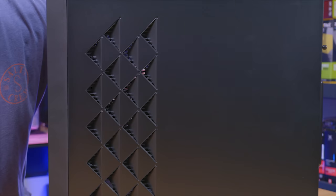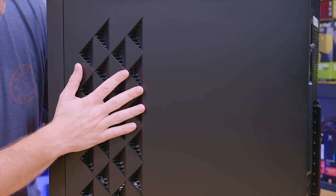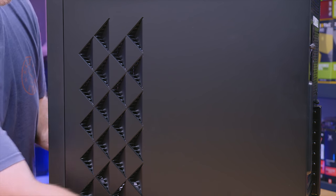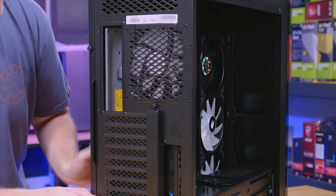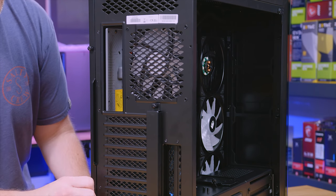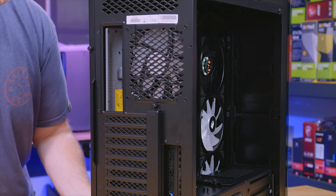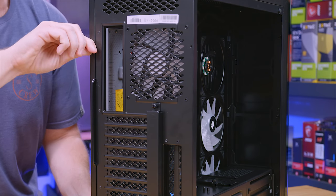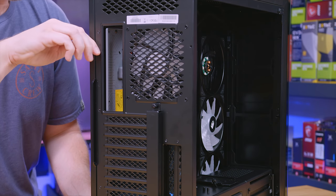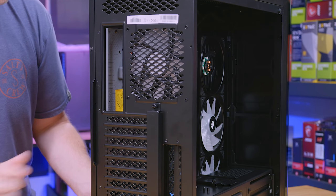You can see on the back right here, this is where it exhausts the air from inside the case — it's an exhaust, so it is pulling fresh air from inside the case and blowing it out the backside. Kind of becoming a thing a lot more case manufacturers are doing now, utilizing this space on the back of the case to keep a more open interior. Though I've not done any testing on whether or not that kind of 90-degree bend the air has to make in that open space could actually affect cooling.